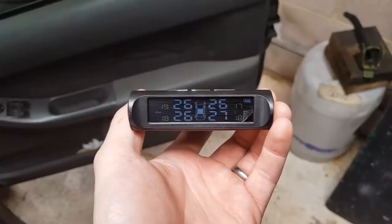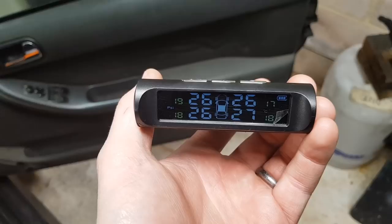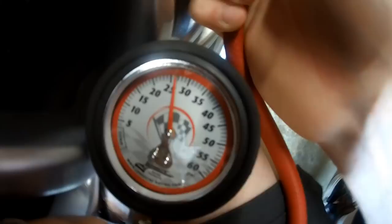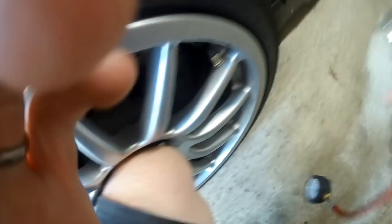So I've just screwed the four sensors on and I've come to pick up the unit to check how we turn it on and calibrate — and it looks like it's already done. It's now showing me 26, 26, 26, 27, which doesn't sound too bad. Checking it against the long acre gauge, that is showing bang on 26, and that is exactly what the TPMS is showing. I've gone around to check all the other tyres and they all read exactly the same. Really confident the accuracy is pretty good — it certainly matches my long acre gauge.